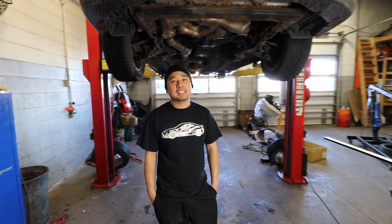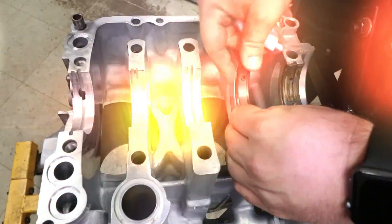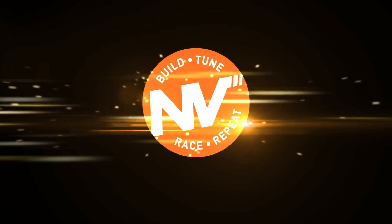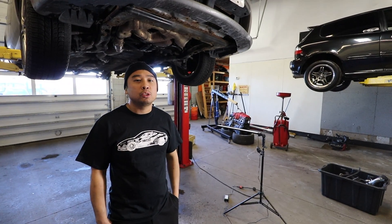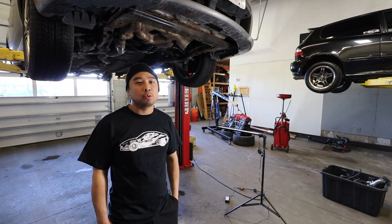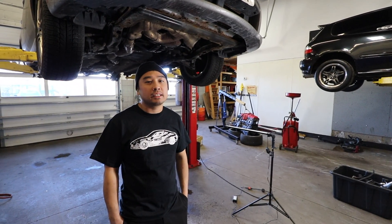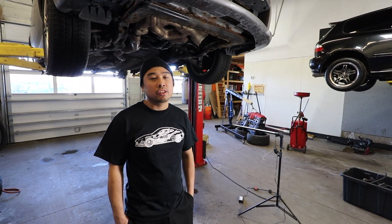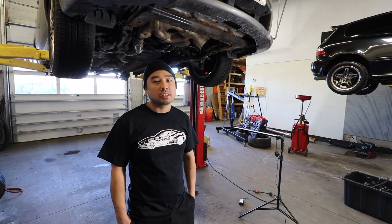It's Nam from Enviata here. Today I'm going to show you what a typical Subaru head gasket leak looks like. Here we have a Subaru 2.5 liter single overhead cam. Usually people associate head gasket leaks with oil and coolant mixing in the system, but on a single cam that's not how it looks — there's usually an external leak, and we'll show you here what it looks like.